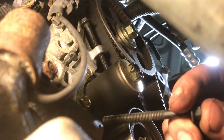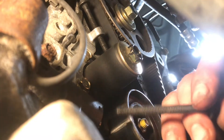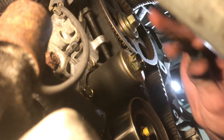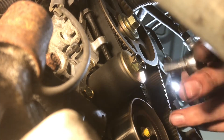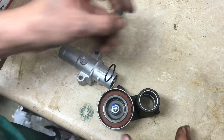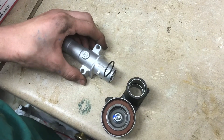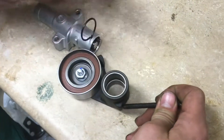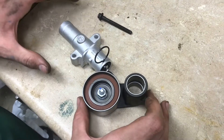In order to remove the tension on the belt we need to back off the tensioner. This piece right here is your hydraulic tensioner, and in order to release the pressure Honda has an eyelet right here — it's an M6 1.0 thread, so I have a bolt just like this. Thread it in there and then with a quarter inch drive ratchet, tighten down on this, which is going to compress the hydraulic tensioner. On the new parts: this is our hydraulic tensioner, this comes out and pushes on this idler pulley giving the timing belt tension. With this bolt we're threading it through that eyelet — when it gets pushed, it's compressing that into the tensioner, spinning and compressing it, making everything smaller which is going to make the timing belt much looser.